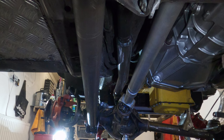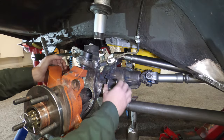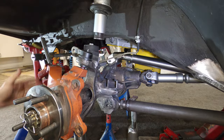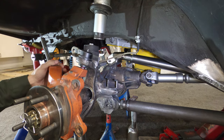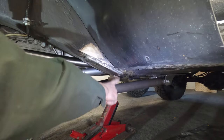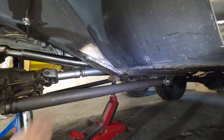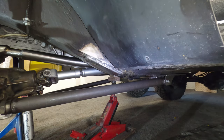This is actually further than it would travel, but you can see everything's looking pretty good clearance-wise. I've got about half an inch between the floor and this link, but you can see some other problems now — the shock mounts, the angle, and contact between the bump stops. That's all stuff I've got to sort out when I pull the axle. One thing I was worried about was the contact points here, but there is so little movement in these arms — you can see plenty of space.